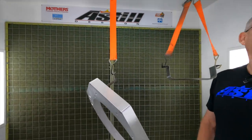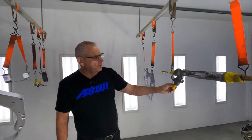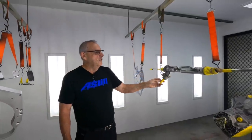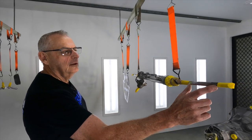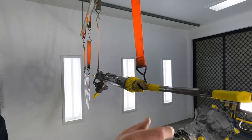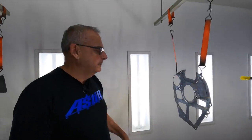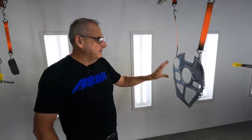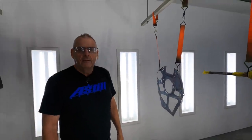Moving over this way — the rack. It's a Commodore rack. We've just cleaned that up, taken all the rough edges off it, and that'll get primed up. We only need to paint this little bit here — the boot goes over that. And then the spacer plate, the sandwich plate that goes between the adapter and the block — you see very little of it, so that being steel, it's been Scotch-Brited and deoxidized, and now we'll put the epoxy on it, get some primer and some paint on it. Kicking goals.